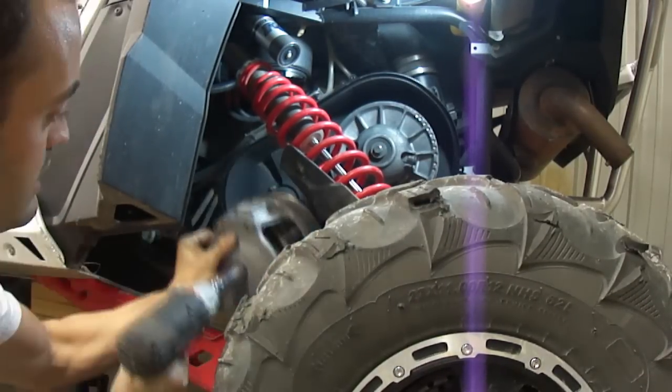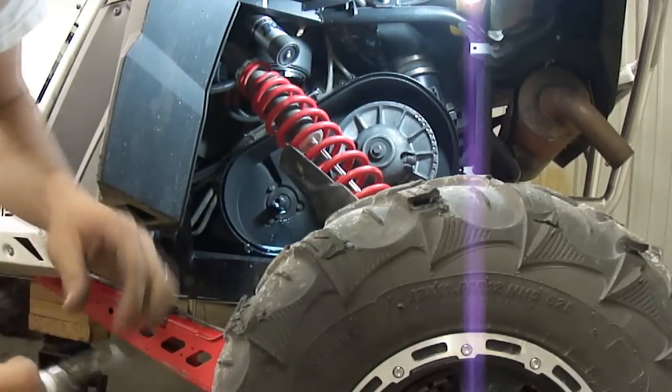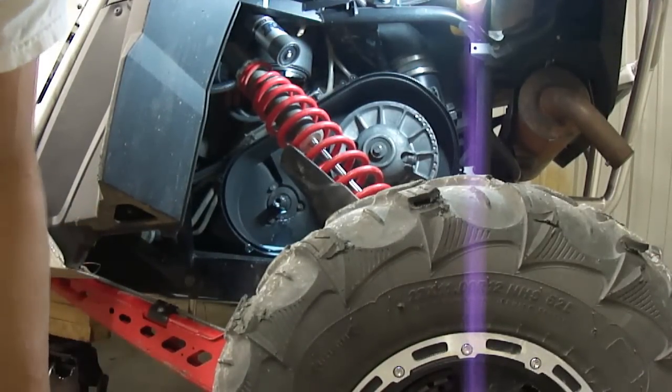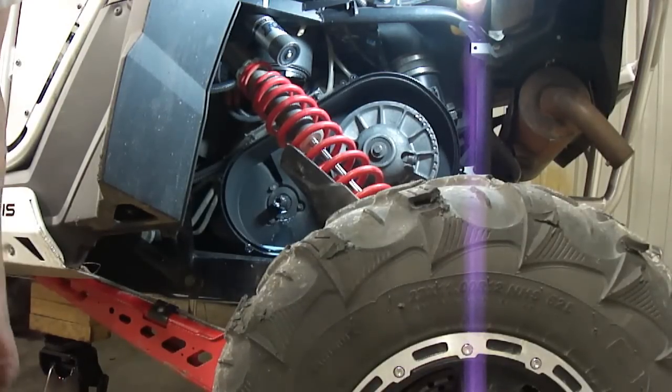And that's how it's done. That's how we get the primary clutch off. I've never had one fail. I wouldn't be scared of the bang that it makes. It's nothing but the hydraulic method pushing the tapered crankshaft and the clutch apart.